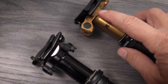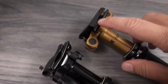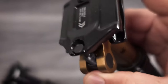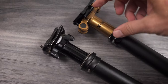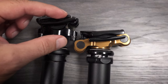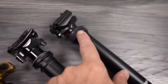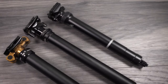The new collar actually allows you to open it up and do minor greasing or re-greasing inside the lower tube — something that the old did not allow whatsoever. Coming up to the top, this is where you're going to see the biggest change. You can see this patent-pending new type of saddle clamp as opposed to the old one which was kind of a traditional style. This allows not only for much easier installation but also provides a lower stack height — fully compressed it's about two and a half to three centimeters. You can see it here new versus old versus PNW Loam — very similar stack height with the new Transfer design.